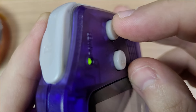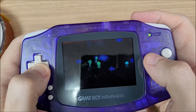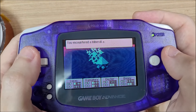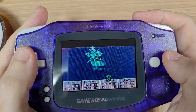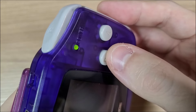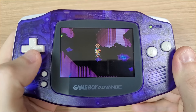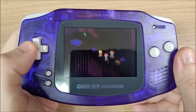But I didn't like the A and B buttons very much. Since these buttons are taller, they become quite sensitive to the smallest amount of pressure, and since they're activated earlier, I wasn't able to perform combos correctly. So I opened the Game Boy again and reverted it back to the membrane buttons, but just on the A and B.